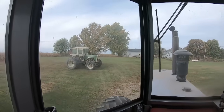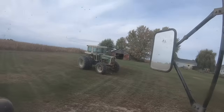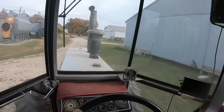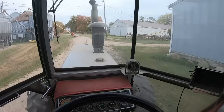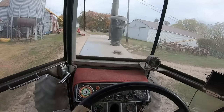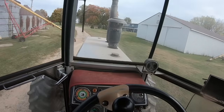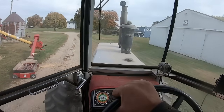There's the 1955. No smell of smoke anymore, battery's unhooked. We'll let her sit out there for a while, and maybe I'll give it a quick wash before I park it indoors. I'm going to have to take some sheet metal off, pull the fuel tank, and then you've got to tip the cab up to get the tank out on those. It's a tight fit. So that's a winter project. I can just add it to the list. We'll see when I get in there whether it needs a whole new harness or just repair what got shorted out.